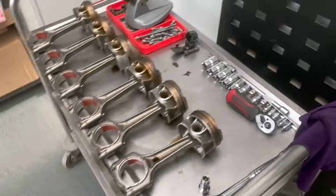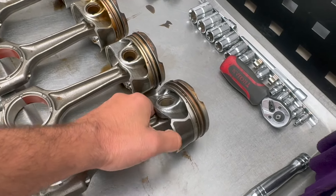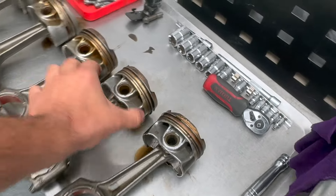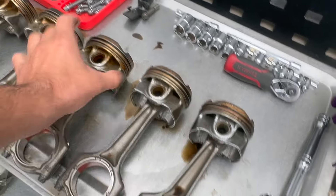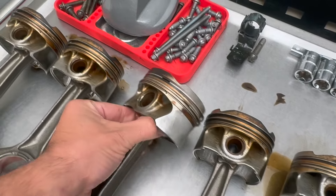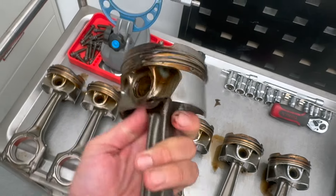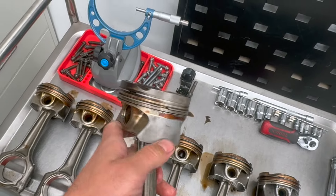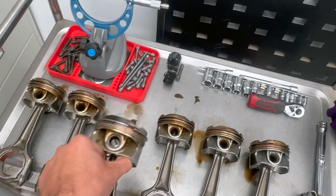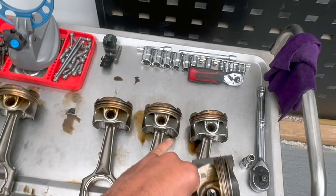However, if you start to analyze them further, these are the skirts — the Teflon skirts. This is a coating that they actually paint on once the pistons are manufactured. When we got to cylinder number three, this is the piston from cylinder number three — there's no Teflon skirt on it. This is where this piston actually measured up 0.05 millimeters smaller than the others, which were already worn out.